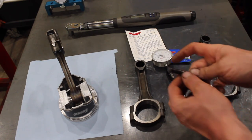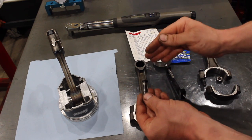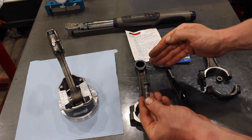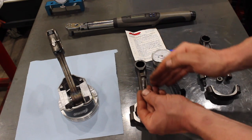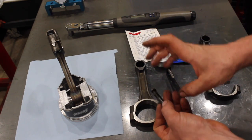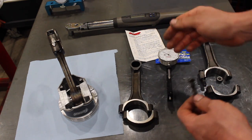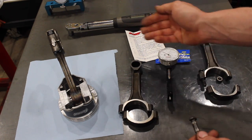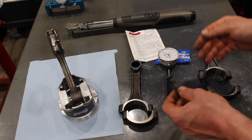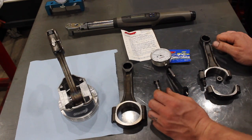If you've ever heard the term 'yield' — when you torque a bolt to yield, that means you've torqued it to the point where it stretches, but any further it will not recover. A bolt will stretch a little bit, but when you loosen it off it'll bounce back like a spring. But if you go to yield or past yield, the bolt is stretched and will not come back fully to its original size. Most torque specs are about 70% of yield to give a buffer, with another 30% before you reach that point. ARP I think is a little higher — 80 to 90%, depending.